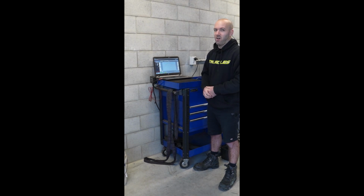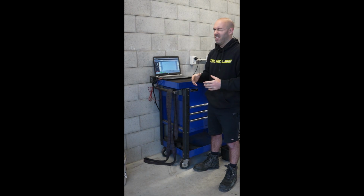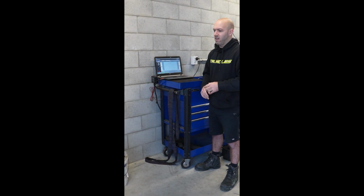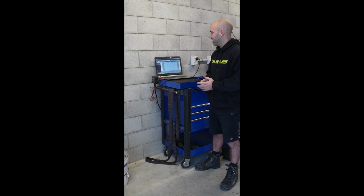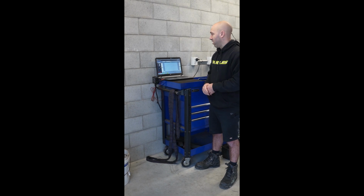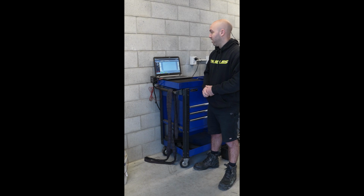Tony did a few burnouts in it on the weekend, and it definitely sounds completely different. Obviously it's very hard to see on the dyno how it drives transiently, but it definitely comes into that boost really nicely. So I'm definitely impressed with that significant gain in response. 1200 RPM is a lot, and obviously making that torque at 3 psi less boost is always beneficial as well.